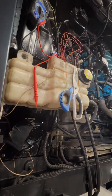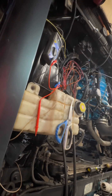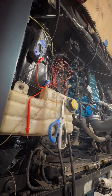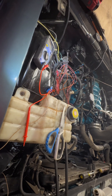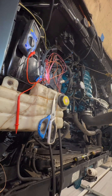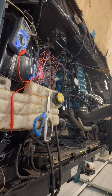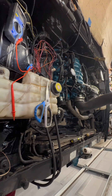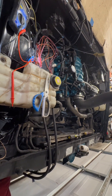I'm running all new power wires for the battery and the alternator. I wanted to go with zero gauge wiring for everything, but I already ordered four gauge, which was factory on this car. So I got four gauge OFC that I'm gonna run for now, and then I'm gonna buy a roll of OFC wire when I run wires for the music system — I'm gonna redo all the power wires then. So for right now I'm gonna run this new four gauge wire I got.